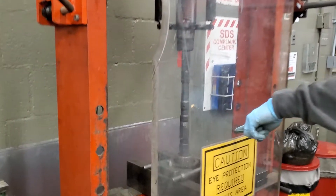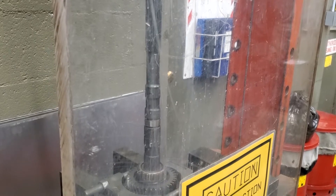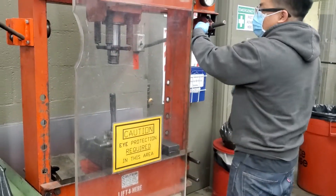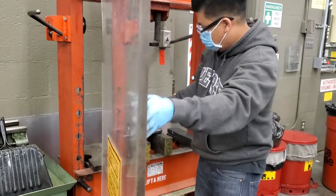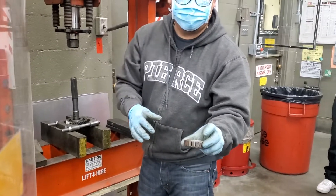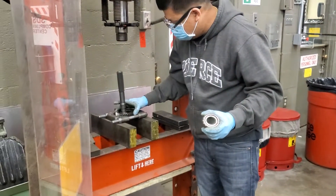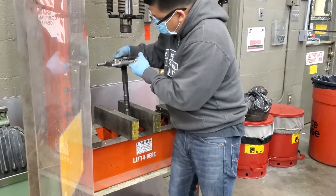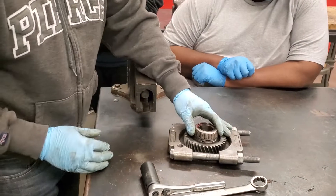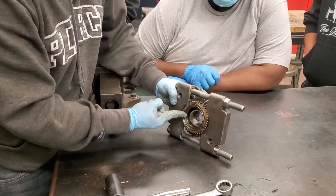Get it close up on the shaft. Ready? There you go — everything is shooting out. Coming out. You got the bearing. Spacer, it goes like that. That's reverse gear. This goes in here. You see? It should have separated. If you time these too tight, it'll bite down on the gear. That's what you don't want — you see that? That's not good.